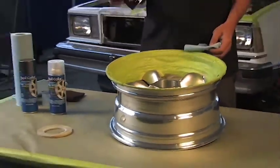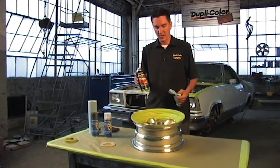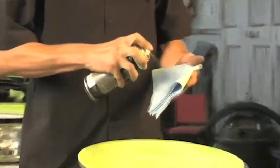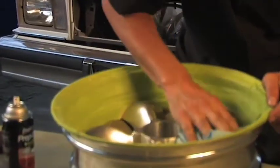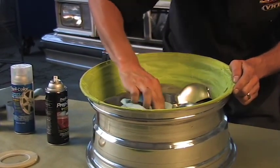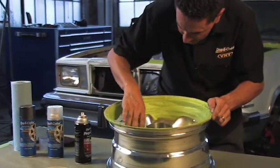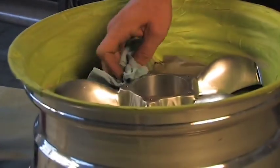With any good paint project comes a little bit of prep. What we're going to do here is go ahead and apply the Duplicolor Prep Spray. After we taped it off and scuffed it down, a little bit of prep will get rid of the oils and dirt and dust that was left over from the scuffing. I'm just going to wipe this on and let it dry for about 10 minutes, making sure it's good and dry before we put the topcoat on. Prep is most important — it did take a little bit of time to tape this off, but the results are certainly going to pay off.